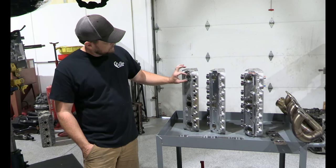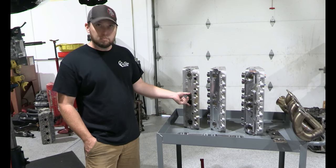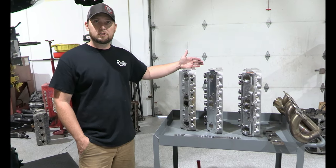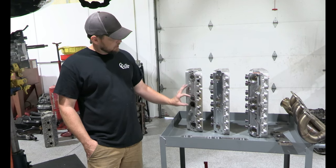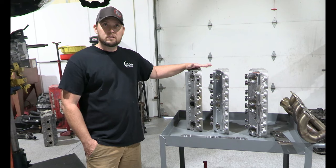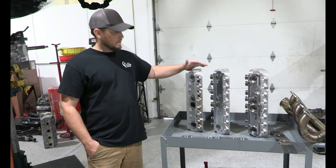Basically, the bolt holes go in really close to the exhaust ports. And then of course you've got two paired ports in the center with only two bolts holding the flange here. So if you compare it to like an LS engine or any other engine with symmetrical ports, they would generally have two bolts supporting each port. So if there's a weakness we've discovered in these engines on the turbo setup making insane horsepower and boost, is just simply keeping the headers to stay sealed up.